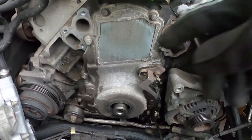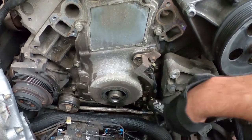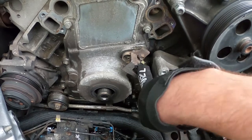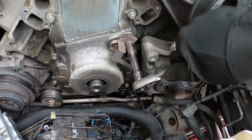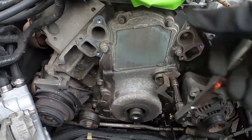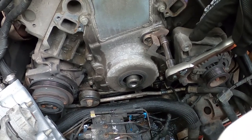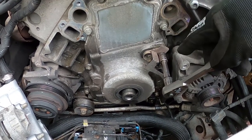With the water pump off and pretty much just out of the way — because the two heater lines are kind of a pain to get off — I can tuck that well out of the way from where I need to be. To take the timing cover off, there's just bolts around it. It looks like I need to take out these bolts because there's a metal bracket and support for this sensor here. Once that bracket's off, I can unplug the sensor and pop it all out. There was still water that poured out from the ports there, so I'm going to dry everything off and clean out those threads inside of the crank pulley hole, just because of all the drilling I was doing.